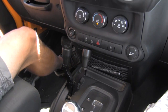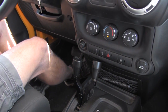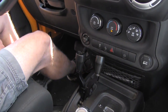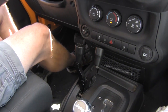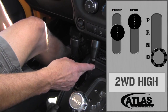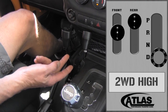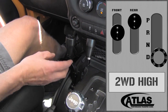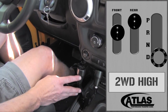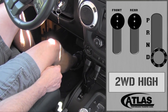This is the install on a 2012 Jeep JK, covering the shifting operations with an automatic transmission. When shifting into high range, this is the rear axle control and this is the front axle control. You can shift into high range at any speed — transmission still in drive. You can give it some gas, let off the gas, and shift it in, and you're in four wheel drive.